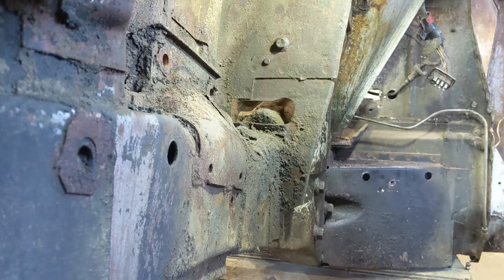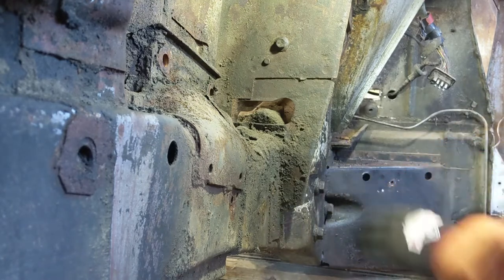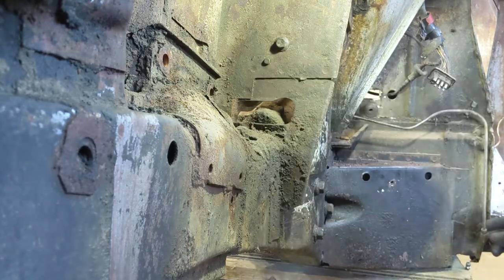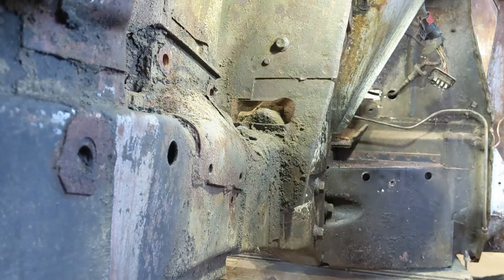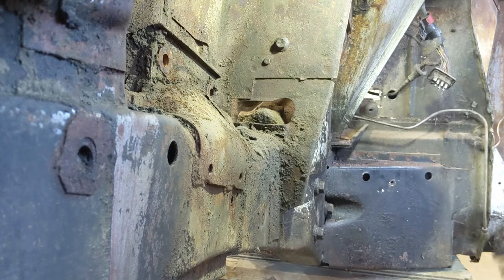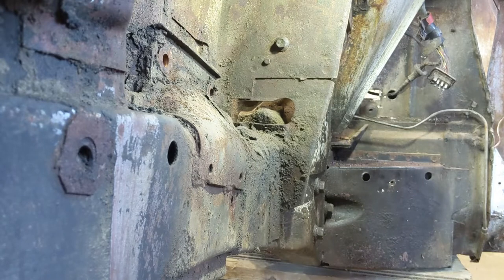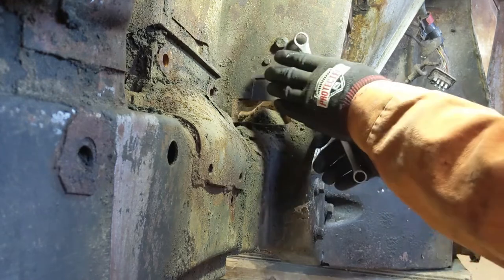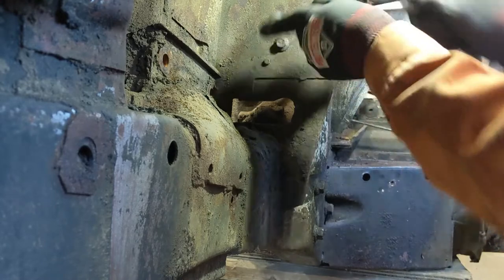But right now, I'm going to take the steering box out, undo the rag joint, and the proportional valve. I don't know if you can see that or not, but the brake line goes down to the side of the car here along the rocker. I've undone it. There's a union there, a junction, a fitting that joins, a joiner, that's what I'm looking for. So let's do the proportional valve, get that out of the way. And that is a half inch. Hopefully you can see that. I think you can. Again, not much of this stuff is on hard.